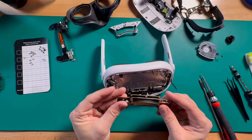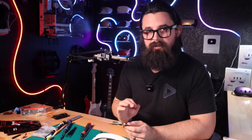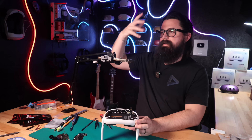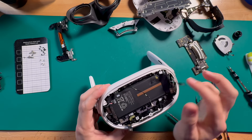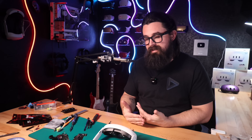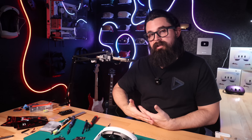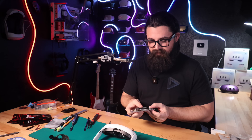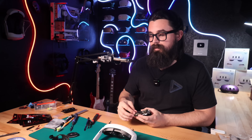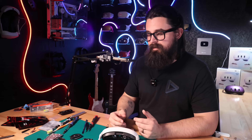Going ahead and popping the board out. No issues, no buildup, no dirt in the heat sink. It's almost like Mateo opened this up himself and cleaned it out before sending it here — that's how clean it is. The final thing I look for with overheating headsets or fans blowing randomly is battery expansion. Lithium-ion battery expansion is pretty common in these devices, especially now that some of them are two to two and a half years old. When it expands due to its placement between the LCD frame and the board, it can put pressure on the board, bend it outward, and push the fan out as well — and that causes fan issues.